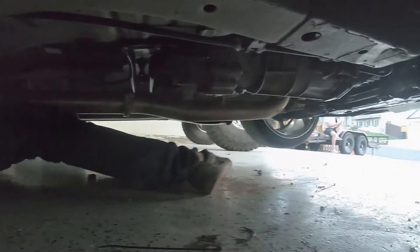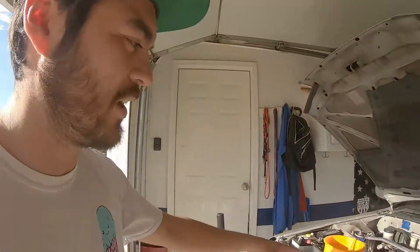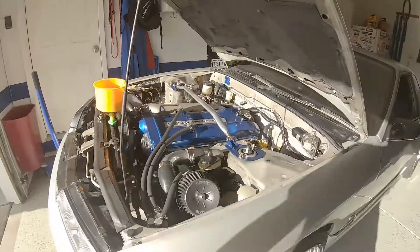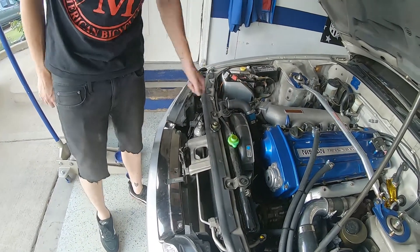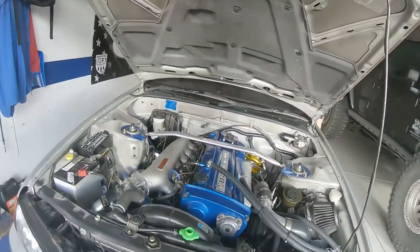Jeff is putting in the driveshaft, then we can fill the tranny up with fluid. We were having issues with the clutch slave cylinder not getting enough pressure to disengage the clutch while the car was running, so we went through and bled every single junction on that whole system one by one — and now it works. We're gonna finish bleeding the coolant and then take her on our first test drive. It's incredibly hot — just touch it man. Jeff won't touch it because Jeff's a weenie.